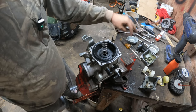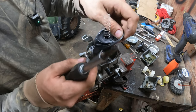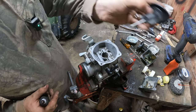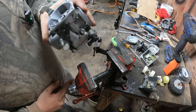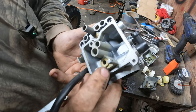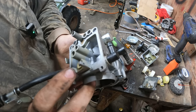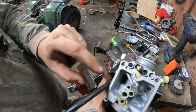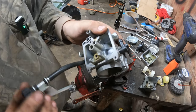That one is a lot cleaner and in better shape. The needle is attached good, the bottom is not melted. We'll go with this body because it looks a lot better. Always make sure there's nothing down in there — if there's one piece of grit down where the float needle valve goes, even a spider web, it'll keep leaking gas. There's also some dirt down in the vent hole on this side. The vents both connect together and come out right here. We'll get it over and drop it in the ultrasonic cleaner.